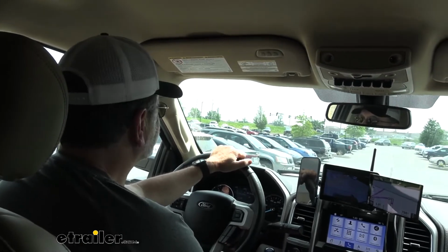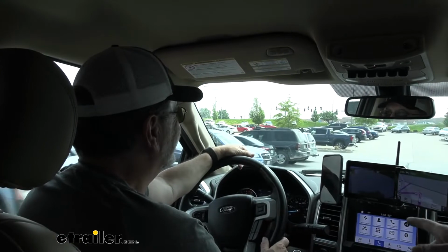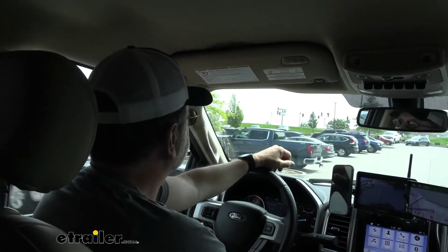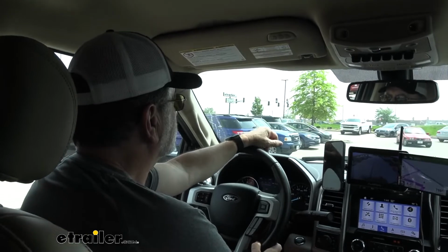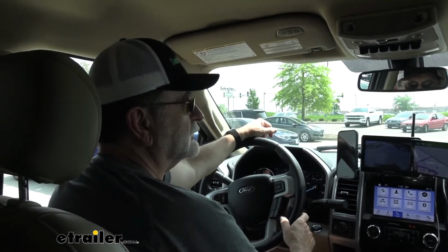Yep. It's almost like it's not there. That's what we like to hear. We didn't really talk about it, but with a lot of these vehicles with your factory controllers, there's an option in there to switch it over to electric over hydraulic. Mm-hmm. We already made that adjustment there. Yes. Perfect. Because if you don't make that change, it may not operate exactly as you expect it to.